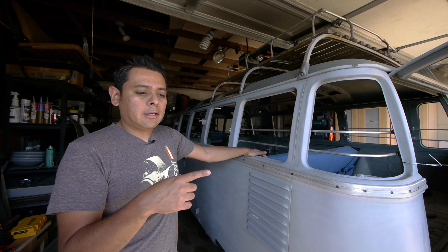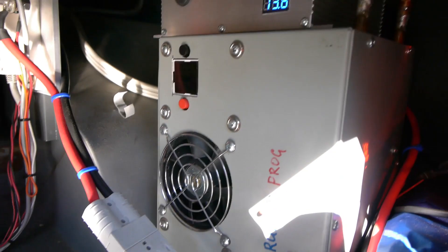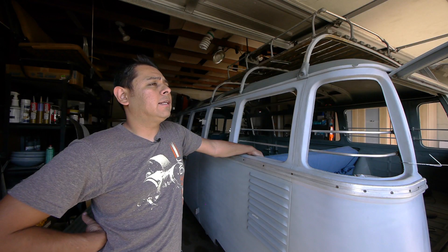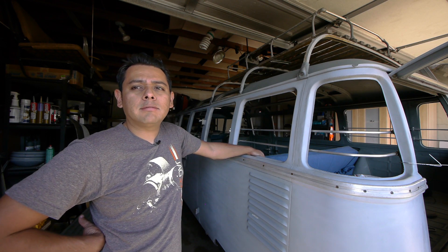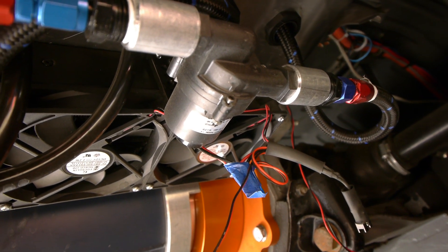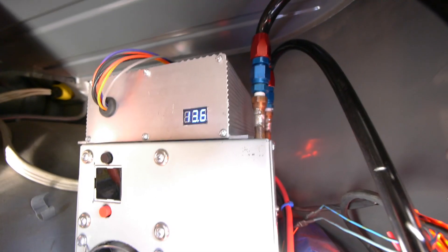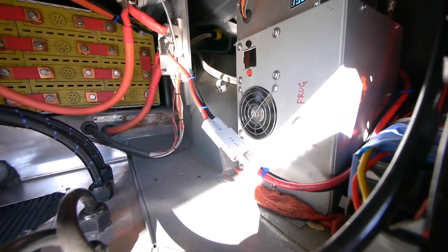This week has actually been pretty interesting. I finally finished my cooling system. I installed all the AN6 fittings and all the hoses. I ended up using two pumps because one just did not have enough power to maintain the pressure required for water flow. My chargers are kind of high up in the system and the water has to travel all the way up there, which is challenging, but I finally figured it out and it's working.